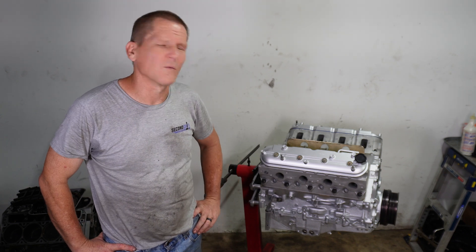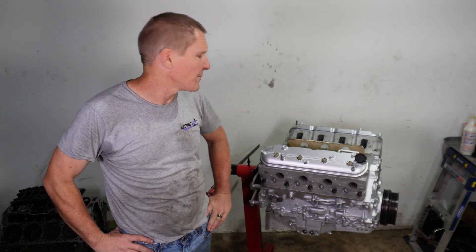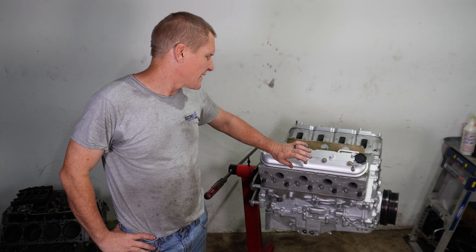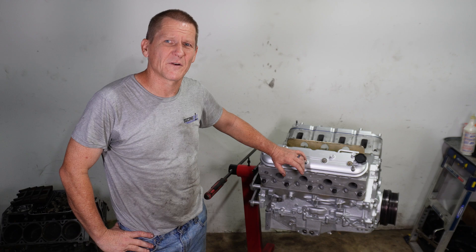The seven-layer LS9 style head gaskets offer an extra layer of protection against head gasket failure. They're more forgiving when the cylinder head starts to lift a little bit. Normally we use those for boosted applications, but I felt it was very appropriate here because we're increasing the compression — chasing the LS7's 11:1 — and we brought our compression up to, I believe, 10.8:1 with the head shaved 30 thou.